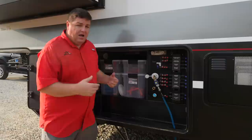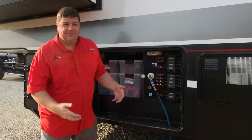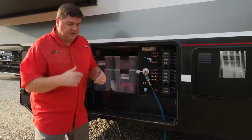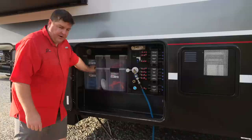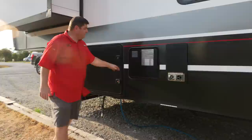We also opted for a washer and dryer but put it in one of the two positions — the forward position we chose not to use, we just turn those water lines off. So I can't get a leak from something not in use. We do use this little flow meter device here — it kind of tells me how much water has gone in the tank, so when we're doing a fresh tank fill I can cut it off when I know I'm at the gallons I want. We also use this area for storage: this bin is our accessories, this is extra sewer stuff, this is fresh water — we always carry a couple of those hoses — and then a utility hose that's not for drinking water, it's for washing things down and spraying stuff off.